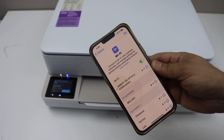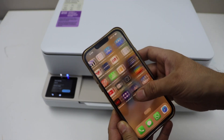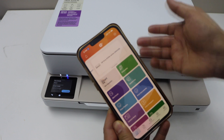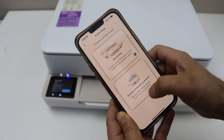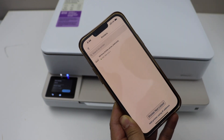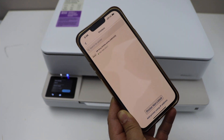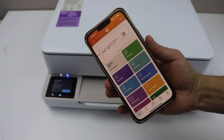The printer is connected to the Wi-Fi network. Next, open the HP Smart app for wireless printing and scanning. Select Set Up or Add Printer, then choose the second option — already connected to network. It will display the HP ENVY 6100 series; just select it and it will instantly add the printer.